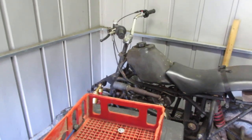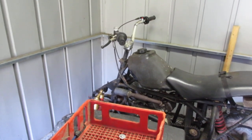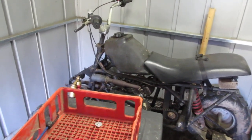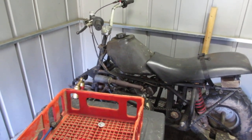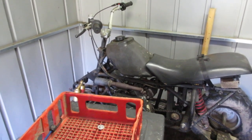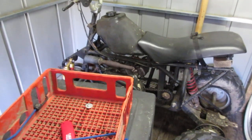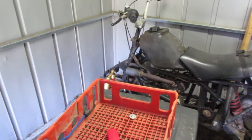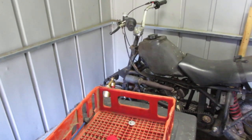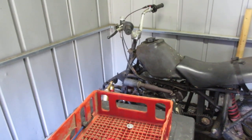I have the Offy in another shed, it runs. You can look up some old previous videos — I got it running for a man, he never did anything with it and he finally gave it to me. So yeah, that could be an opposed twin Briggs, 15 horse with dual exhaust. But I need a five-speed Peerless transmission. I believe a lot of them come off those old Snapper Comet and look-alike Sears behind-the-seat mowers. Anyway, I need a chain drive output transmission and I can finish up this build like I want to and make it a three-wheeler most likely.